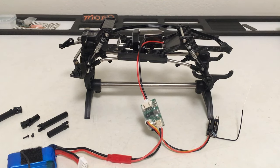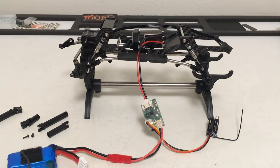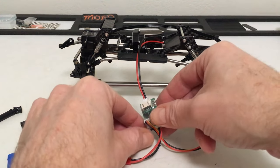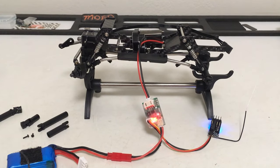And of course, I did set the low voltage cutoff on this guy as well, because that doesn't come preset. Once you reflash it, you still have all the same basic settings as you did on brushless. So none of that changes. I didn't adjust anything. I just set the low voltage after I flashed it. So I have gone ahead and bound this. So we're going to give it a little spin here. And he did warn me that because these magnets are so massive, there is some lag on the throttle pull, that it's got to get a little juice to get those guys going.